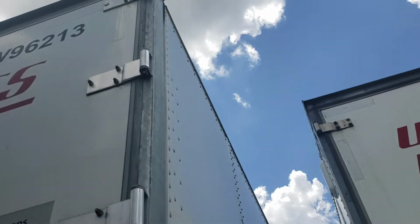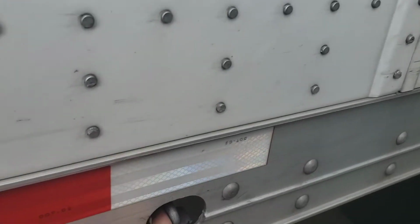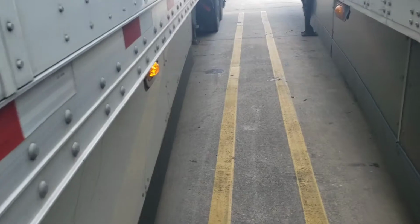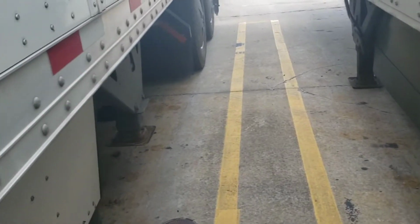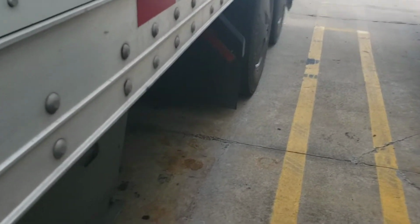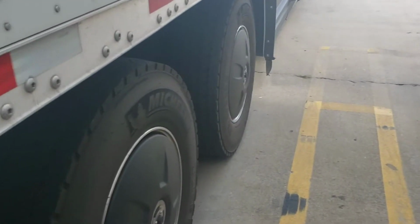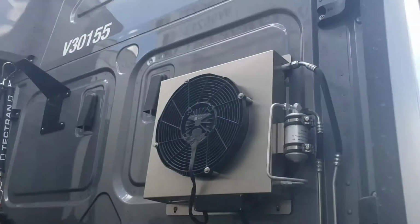Again, all hardware on the trailer is secured. Again, this hook, in good shape. Mud flaps. Tires properly inflated and secured. Lights properly working. Notice if there's any damage to the skirting. Make sure landing gear is up on this side, because I have seen landing gear that would break and only one side would pick up. Again, mud flap, tires, fenders. Yes, that's the APU running.